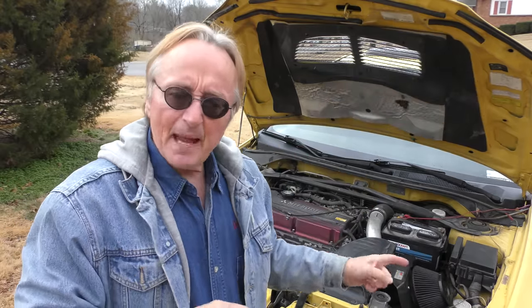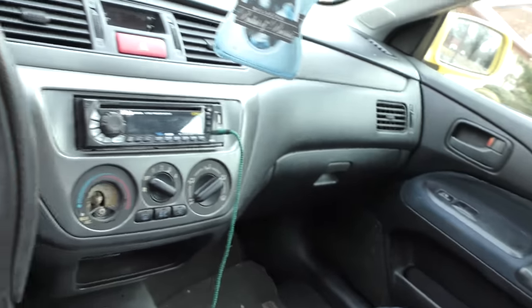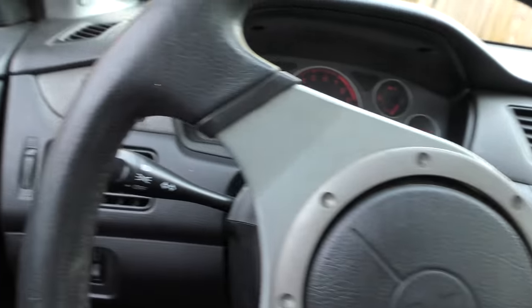This is what I see all the time, which is why I advise people not to do it. This car originally came with a turbocharger — it was designed that way. But like many Mitsubishi vehicles, it's cheaply made, because if you look around there are no boost gauges. So you have no idea how much boost this thing is putting out. That matters a lot on turbocharged cars — you need to see if it's boosting the right amount of pressure or not working at all. If you've got a turbo on a car, you really need a boost gauge.